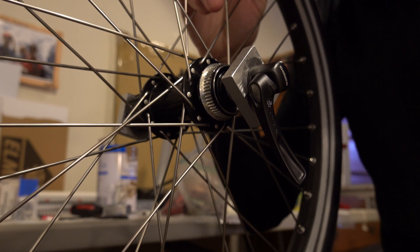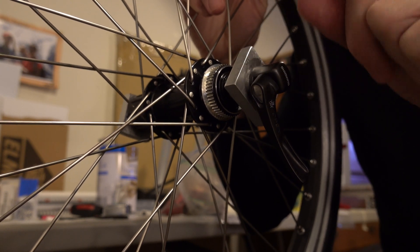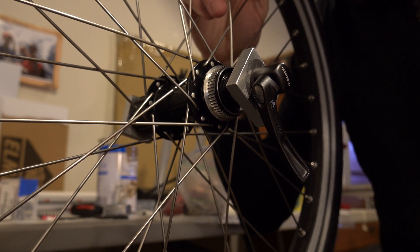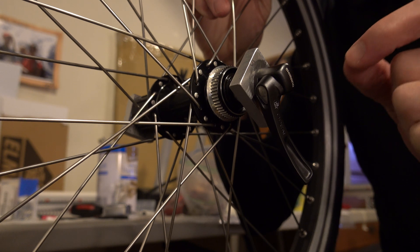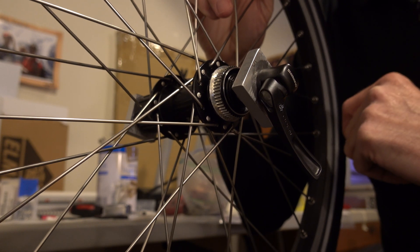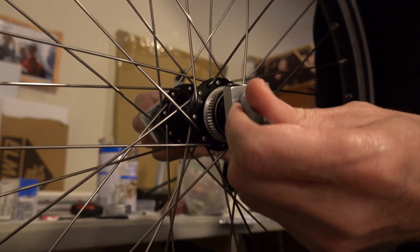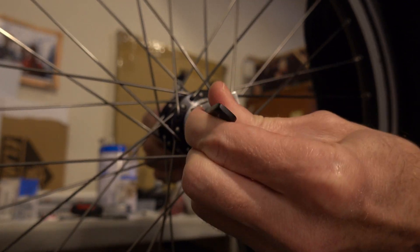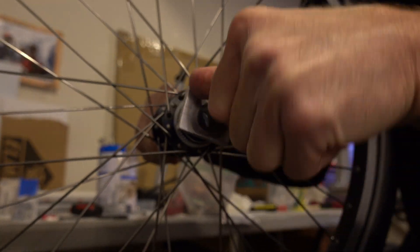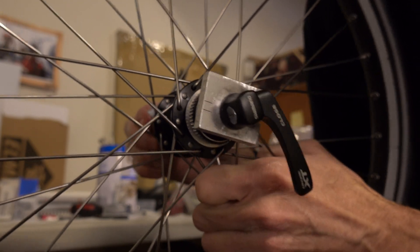So that's the way I do it. I'm not an expert, but it's the only way that's ever worked for me. Make yourself a couple of metal dropouts and check your work over and over again until you get to the point where there's about a half a millimeter of play - a little bit of tick when there's no quick-release skewer in the hub. And when you clamp it down at regular tightness, which should be when the skewer starts to tighten when it's about halfway, that play should be gone.